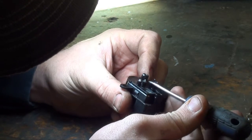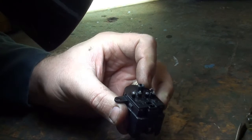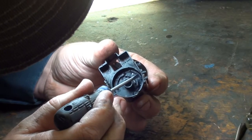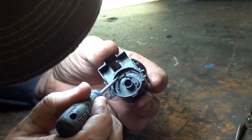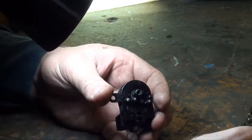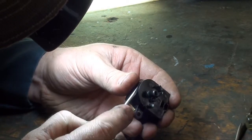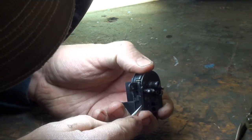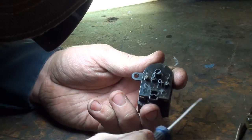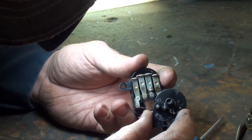Look how low that tab is. It's worn down. And the same thing with these plastic pieces in here. There's grooves worn into them. So over the years, the plastic part of the switch is simply deteriorating, wearing down. So let's open up this and see what's underneath there. We know it's this one right here that's worn down the most. Let's see if that's our start contact.